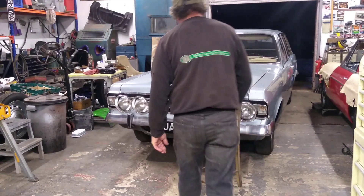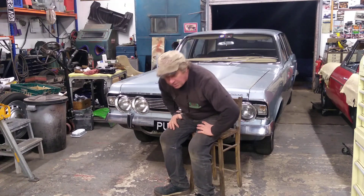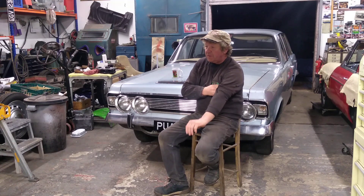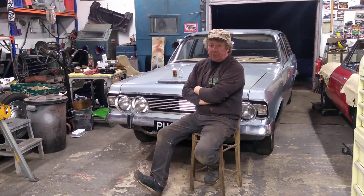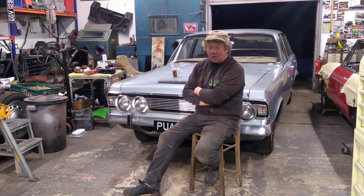Hi everybody, hope you're all well. It's a bit of a miserable day down here, pouring it down. When I came down in the Zephyr this morning, a couple of presses on the pedal, fired up, ran straight up on cam on choke and started. If you read the manual on that car it says press the pedal once, but it never catches cam on choke first time - you have to do it twice. That's just my knowledge from being used to the car.